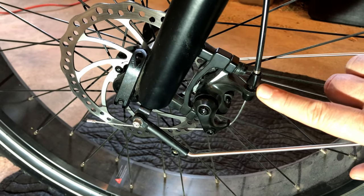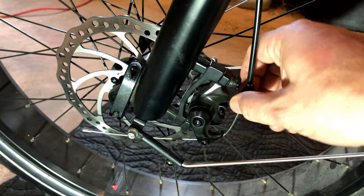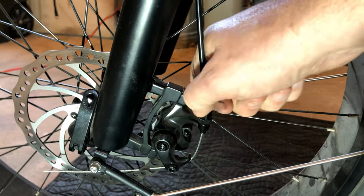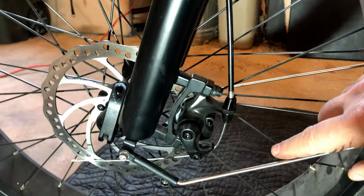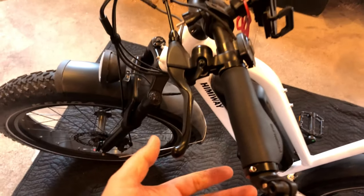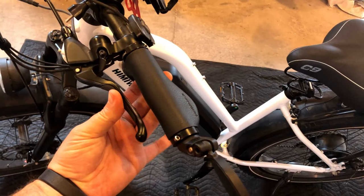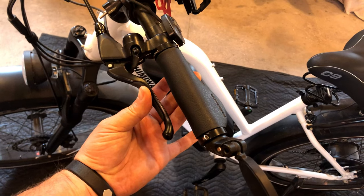We'll also repeat the process down here with this barrel connector — loosen the lock nut all the way up and then tighten the barrel itself all the way down. That puts all the extra slack in this cable. Now you'll notice that with both barrel adjusters tightened in, the brake handles will go clear back to the grip. This is not what you want — you want the brake handle to stop short of the grip when it's fully engaged. So we need to make adjustments down on the calipers to take that slack up.